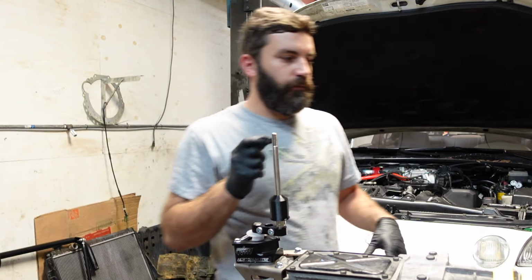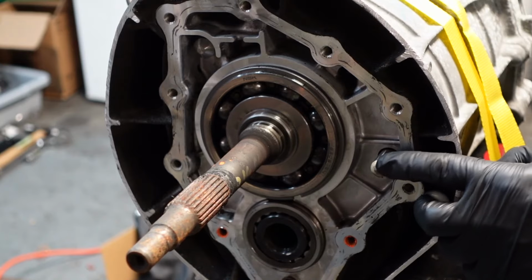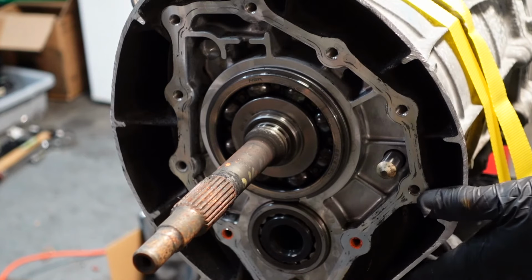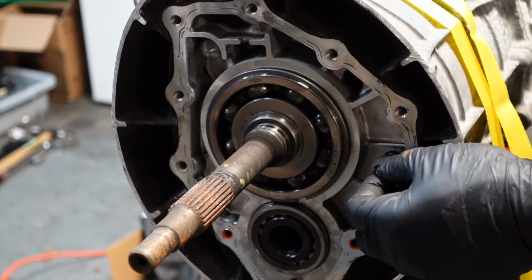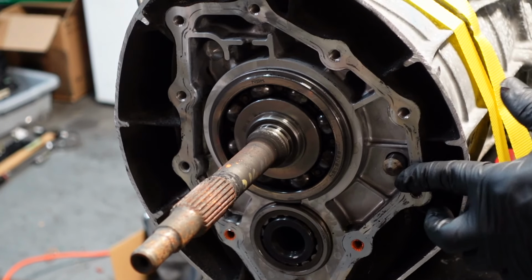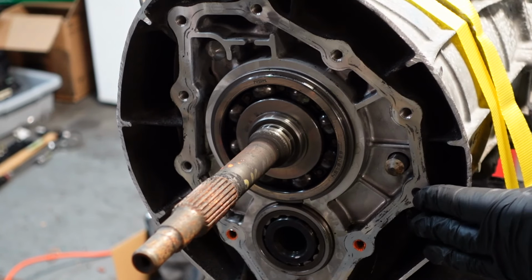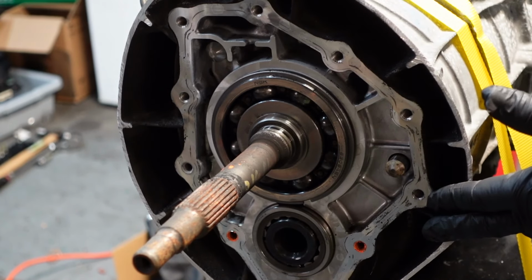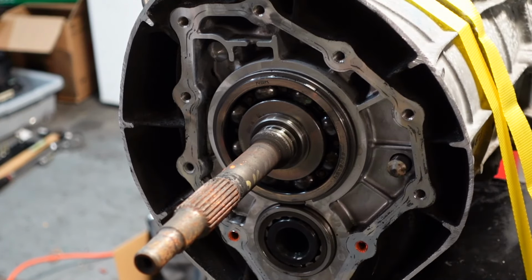And why we need to get it into 5th, I'll show you up here. So you see this rod right here. We need to basically shave it down a little bit and round it off. It's got a flat tip, almost comes to a triangle. So you'll see how when you go into 5th gear that comes out. And if you don't do this, it'll hit the back of the adapter plate and possibly prevent you from going into 5th gear. I actually did this myself once. I saw Taylor Ray actually did it to his Miata at one point as well. But 5th gear is obviously not that important when you have a drift car, but this is going to be a street car / drift car, so I want to have 5th gear. So we're going to shave this down and clearance it.